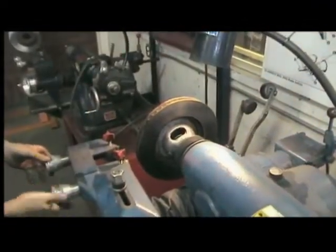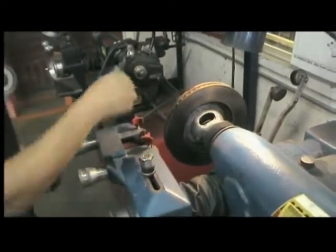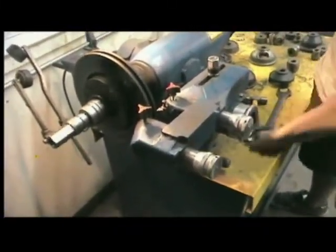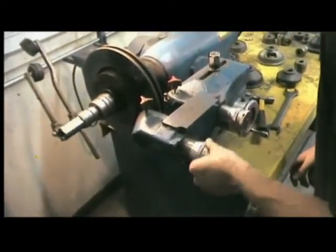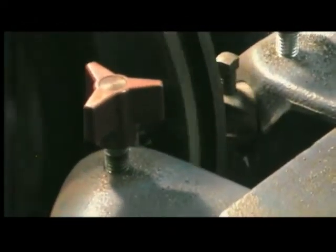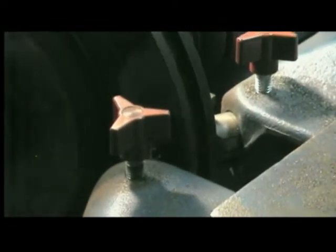Back off the grinder so you do not hit the rotor right away. Make sure the shaft has no play up or down or side to side. Go halfway in on the rotor, and once you are halfway in, stop and turn the grinders in until they touch the rotor.